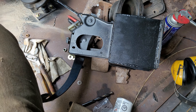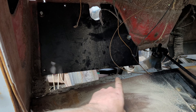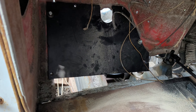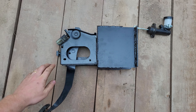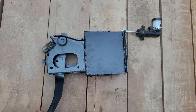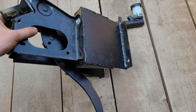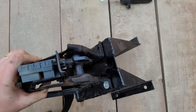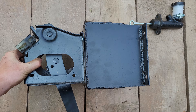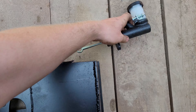Of course the next problem we have to deal with is that I don't actually have a pedal or clutch system yet — at least not installed. This truck originally came with under-the-floor pedals. You can see the gap where they used to go here, but that won't work with my current setup so I built this instead. The pedal itself is from a Chevy Colorado and the standoff it's attached to is something that I built a few weeks ago in order to get the pedal secured to the firewall and located in the correct position.